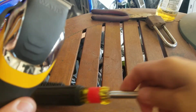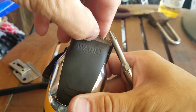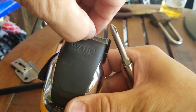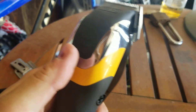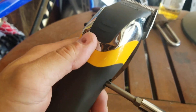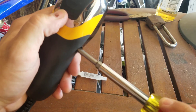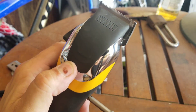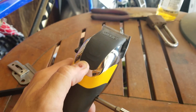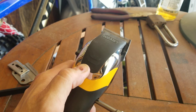Next thing I would do — turn it on. If you pinch this blade, it should be able to stop. So the small inner blade will stop — that's how you know you're good. Also, take your adjustment screw on the side here, know where you're at — I'm at about 12 o'clock. Turn it. Do you hear a buzz? Go back a little bit, past the point when it stopped buzzing — that's when you know it's good.